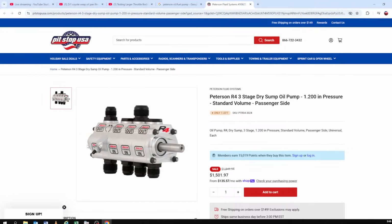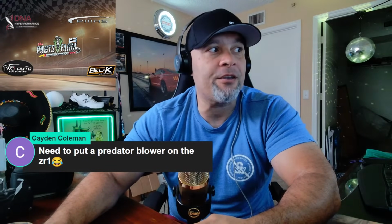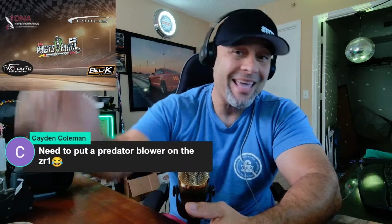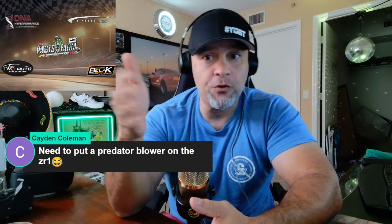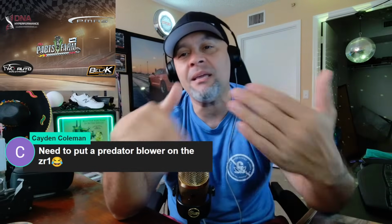Now we're talking about tanks. Now we're talking about bracketry. Now we're talking about lines. Understand, guys, it is not cheap. And now I don't want to have this situation. Now I could do, because I'm a pump guy, I know 100% I can probably incorporate an electric oil pump in the situation, but that's going to be a little more integrated, and you're going to have fail-safes set up in such a way that if the oil pressure goes under a certain amount, the engine shuts off. So that's going to be more involved.